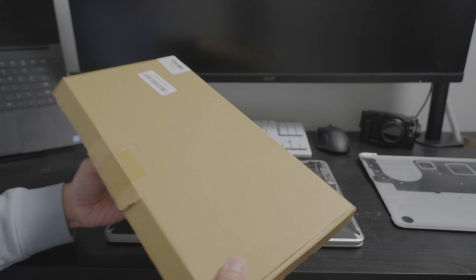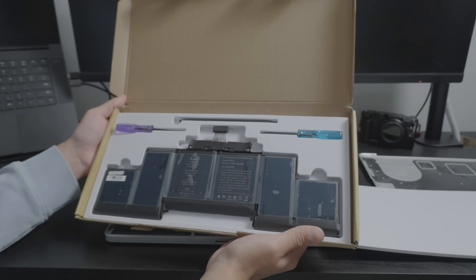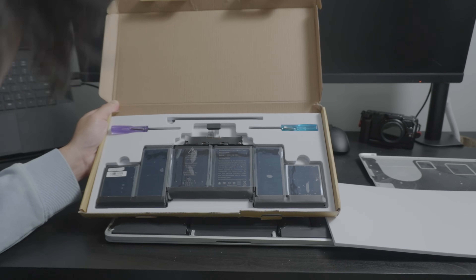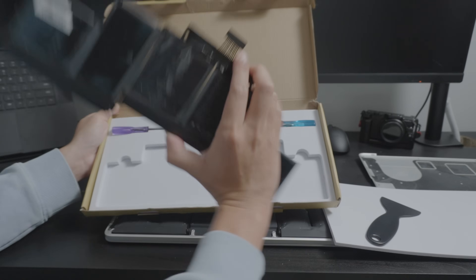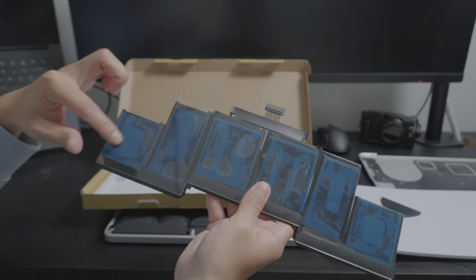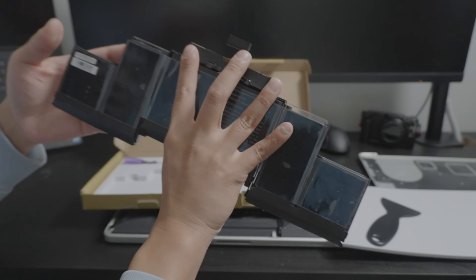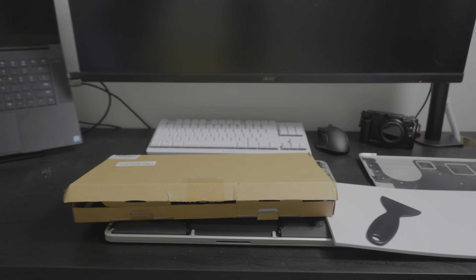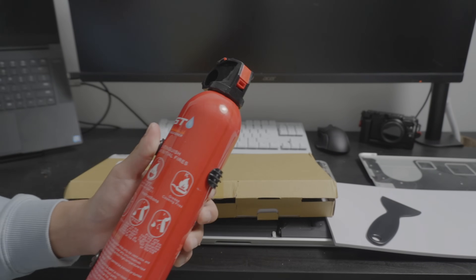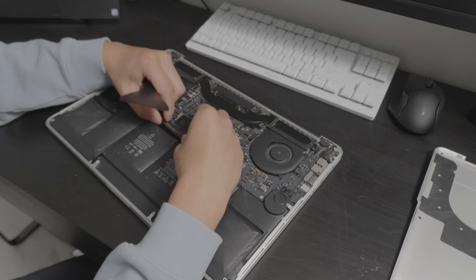The most important thing for this computer is obviously the battery. I got this one on Amazon — link will be down in the description — and this was one of the better-rated ones. It came with a battery remover tool, which we're going to need. We need to do this carefully because the adhesive becomes very sticky over time due to heat and cold cycles. With a swollen battery, you really have to be careful not to touch any sensitive areas. I have a fire extinguisher right by my side — this is the first time I'm quite nervous about this.